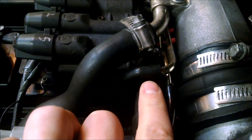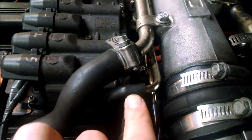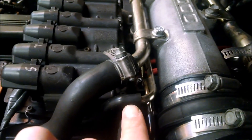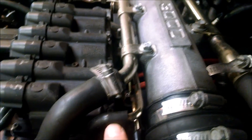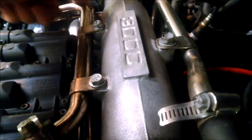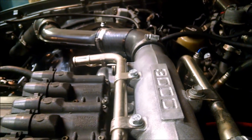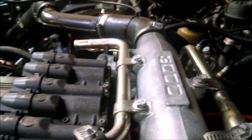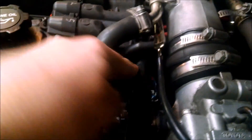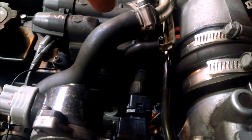The next largest is the bypass valve or blow-off valve vacuum signal. This is how that valve knows whether the engine is under boost or vacuum and when to open the bypass valve or blow-off valve. It normally routes this way and then you can see it coming out here. So then it would go onto the accordion in the factory intake setup where the bypass valve is mounted. It comes around here and goes down. There's a strange little metal pipe that takes it from the top side of the intake down to the bottom side of the manifold.